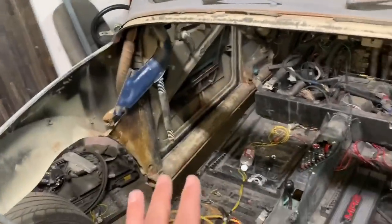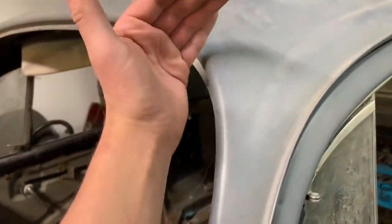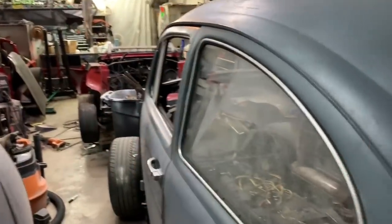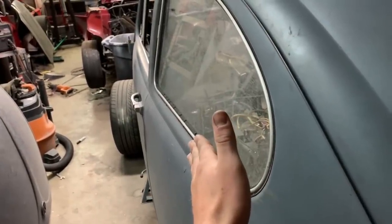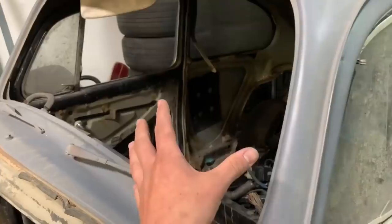At this point the bug is pretty flimsy. I know this is a stupid idea, but hear me out. If we cut slots roughly here, here, and here — just little slots with a cutoff wheel — and get the entire side to basically pivot separately from the roof, we might even cut a couple random slots in the roof on this body line. If we can get this to pivot and pull the bottom out 3 inches on each side, we'll be able to put the bug body on without cutting it in half.